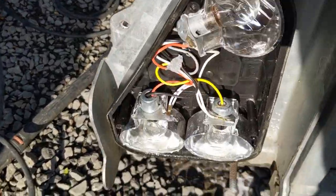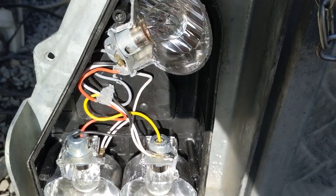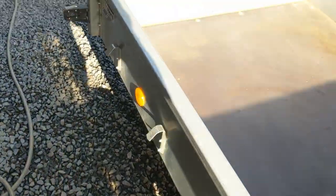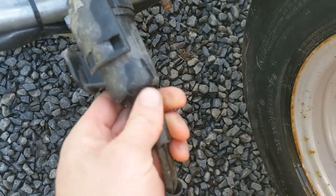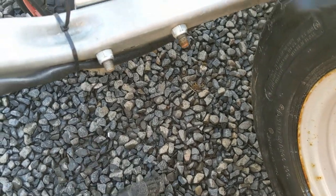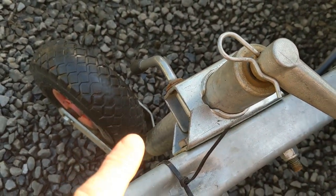If you're being fussy and your lights were always full of water, you could take the connections all out and put a bit of dielectric grease in them. You should also put a bit of dielectric grease in your seven-pin socket - well, I've got an adapter because these now in the UK come with thirteen pin from the factory. If you're being really fussy, you could also undo your jockey wheel and fill it with multipurpose grease.